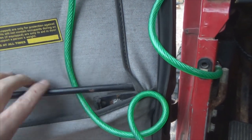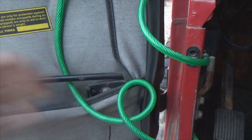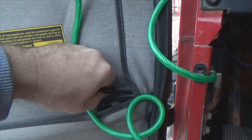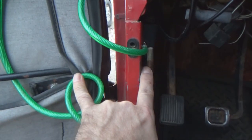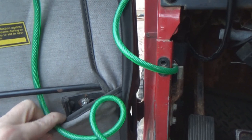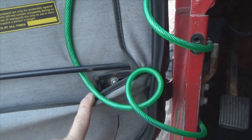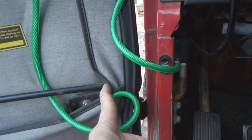Making our limiting straps - I've got two different choices. I have Best Top Super Top full soft doors and you can see this cloth material. If you've got hard-sided doors you've got different anchor points, but the principle is the same. I'm looking at possibly doing a small loop here, loosely tying the loop, then creating my limiting-length loop from here to here. I could tie them lower but it'll hold the material down, which looks a bit tacky. Up here the cord slides right here and stops.